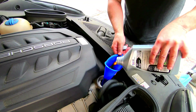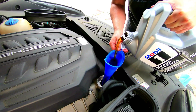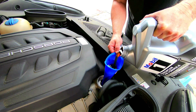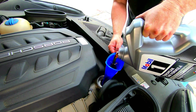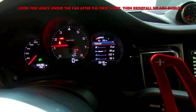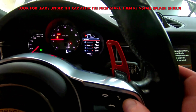After that's done we'll go ahead to putting oil in. What I didn't show in the video is the other five-quart jug I already dumped in, so you're only going to see me putting in three and a half quarts. I usually start with eight and a half quarts, drive it around, check the oil, and add if needed — but eight and a half quarts usually gets me perfectly there. Put the oil cap back on, start the car up, and get it running. You won't be able to check the oil yet because it needs to warm up, so you will have to drive it around.